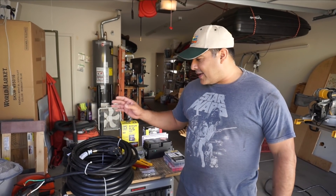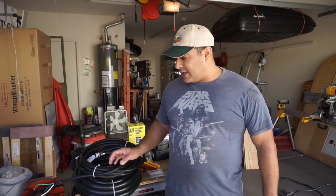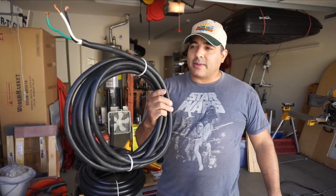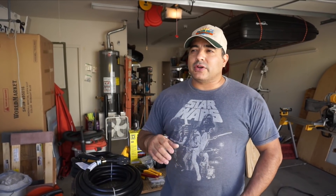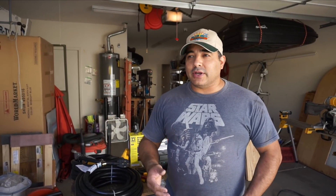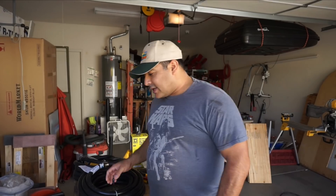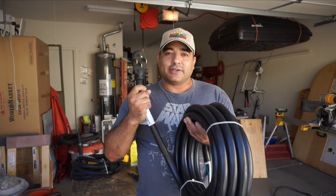It's electrical day today. We're going to focus on the AC side of the bus, meaning the shore power side of hooking things up. Our bus came with 30 amp shore power, but we are switching to 50 amp primarily just for the flexibility. There are down converters — we can down convert it all the way to a 15 amp, just plug it in with a home extension cord type thing. For maximum flexibility, we wanted to go with 50 amp, so 50 amp made more sense. We bought the cables and the cable is significantly larger — this is a 50 amp cable.